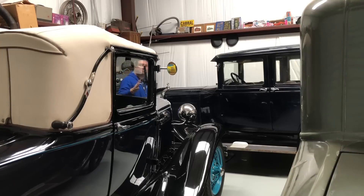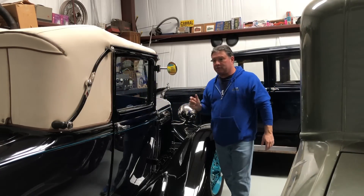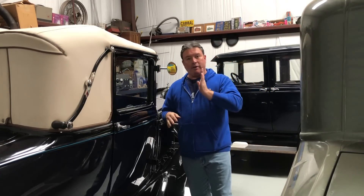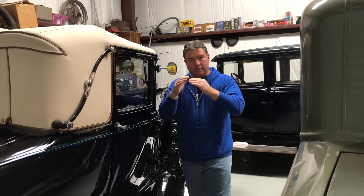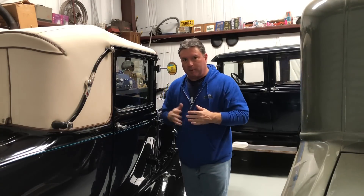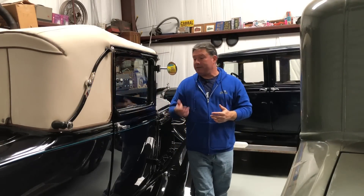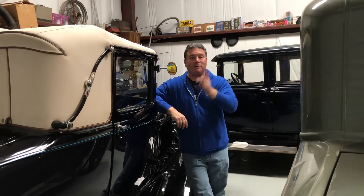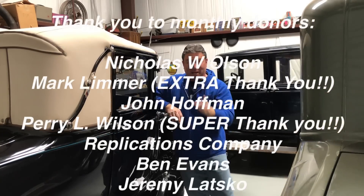Made it back into the shop just before it started to rain — perfect timing. So there it is. The '31 Sport Coupe is driving fantastic. Now it goes straight down the road with the steering box at the center of its travel, at that nice close mesh spot. So there's not a lot of play in the steering, no wandering. It drove good before, it drives even better now. Thank you so much for watching the video. I can't wait to see you on the next one. I've got lots of surprises coming up — and Merry Christmas.